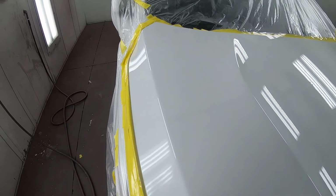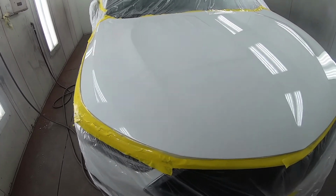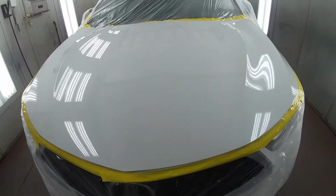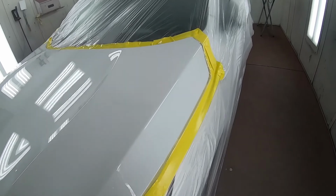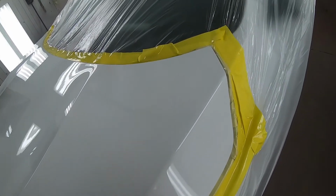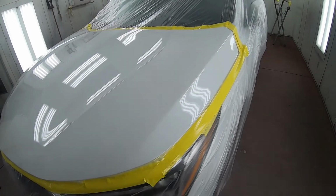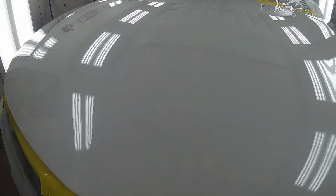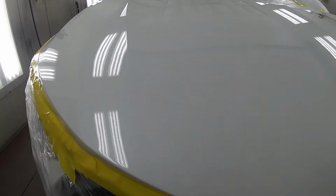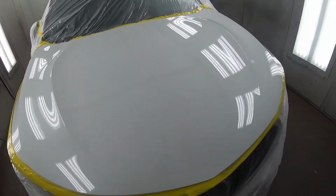And just like that, the dieback problem has been eliminated. Now guys, I could have gone the route of buffing, but just think about how much time and material you would waste, especially the sandpaper. 2000 is very expensive. All that material you would use to cut about 30 to 50% of the clear coat on there, which means in a few years, it'll start to die back and look pinchy again. Whereas the flow coat just added a longer life, a longer UV protection to the panel. So this is why flow coat is always better.